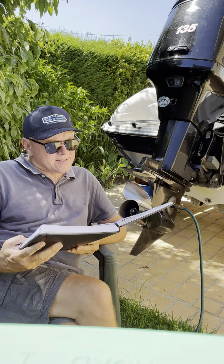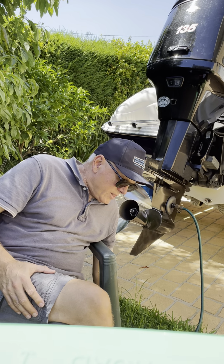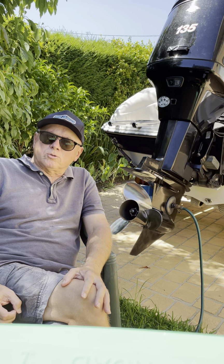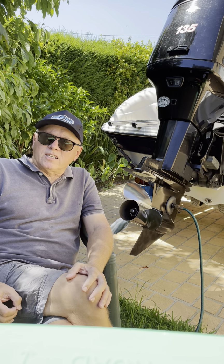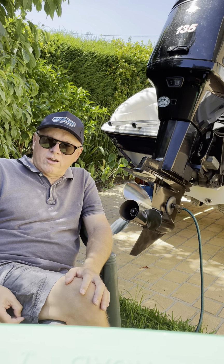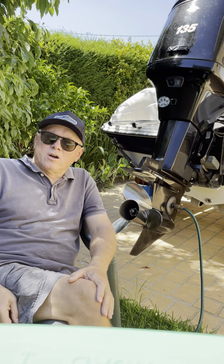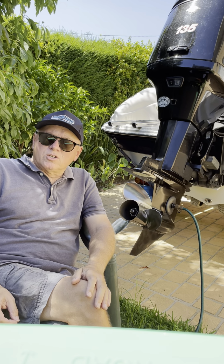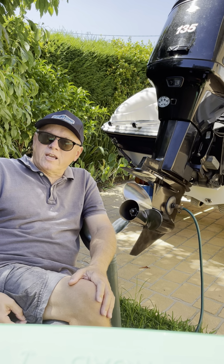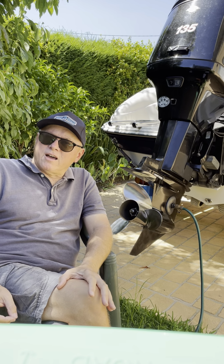Again, I'll just check my notes. Oh yes, when the Optimaxes first came out, there were a lot of early troubles. Things like broken alternator bolts, broken air compressor bolts, pistons sticking in cylinders, causing massive failures. And it took them quite a few years to sort all this stuff out. And so in 2001, they actually suspended production of the Optimaxes for a time, so they could sort all these problems out. But they did that. And so what it means is that if you can get an Optimax that's probably about 2002, 2003 onwards, then you're going to have a very good engine.